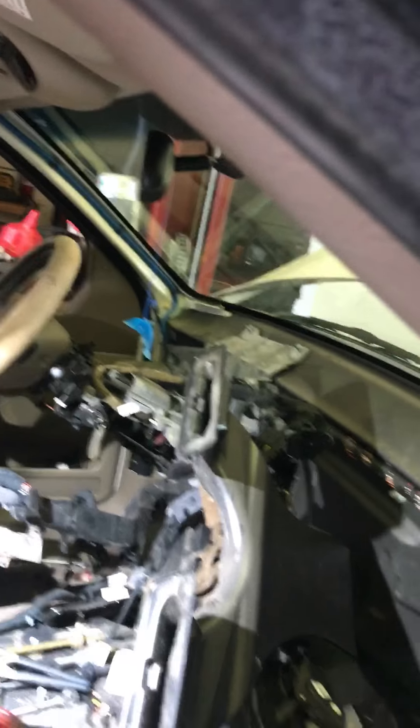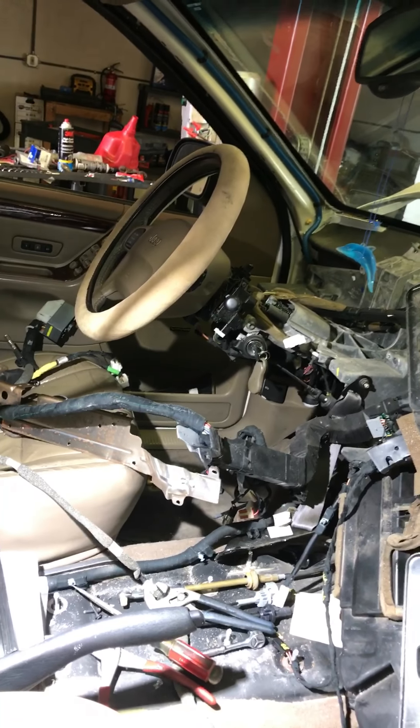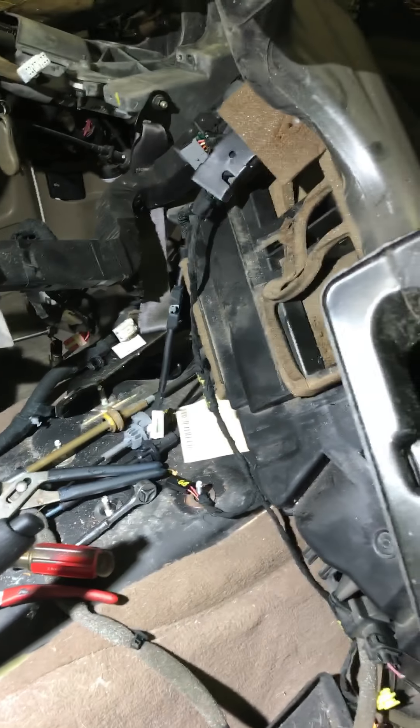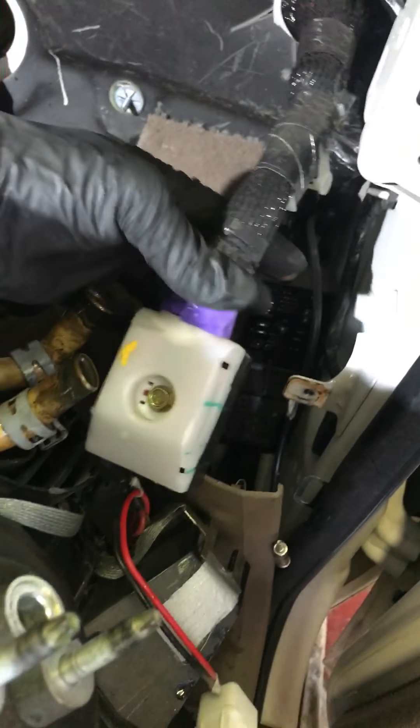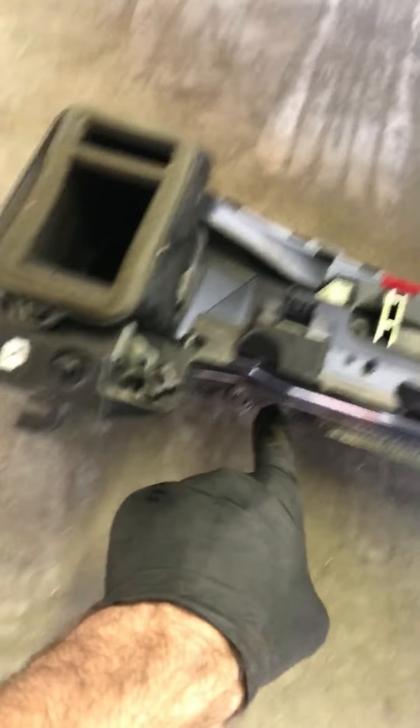There's going to be a little photo sensor up there for lighting and so forth. The steering column does not need to come out — thank Jesus. The wiring harness is held in by little 7mm screws at various points. This thing came apart pretty easy. Obviously you've got to remove the cluster. The wiring harness goes through there. I disconnected the computer down here. The second stage will be this cluster here, which is held in by 10mm bolts — five of them around the cluster.